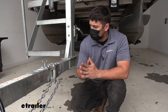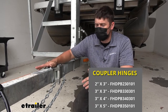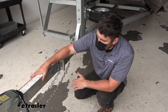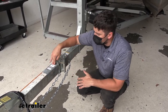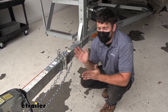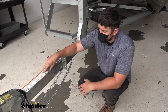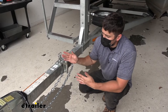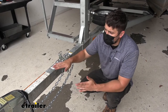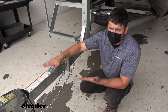We do have a couple different options here depending on the size of the frame on our trailer, so no matter what size frame you have chances are there's going to be an option to install one of these kits. In regards to the amount of tongue we can have swung away, the maximum is going to be 48 inches measuring from the center of the hitch ball back to the point on our frame. There are a couple different variables — the size of the frame and the tongue weight. In the instructions there's a handy chart: once we input the tongue weight and the frame size we'll be able to determine the max amount we can cut back from the center of the hitch ball.